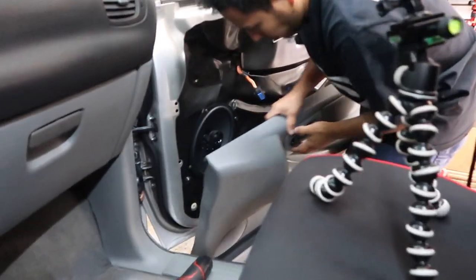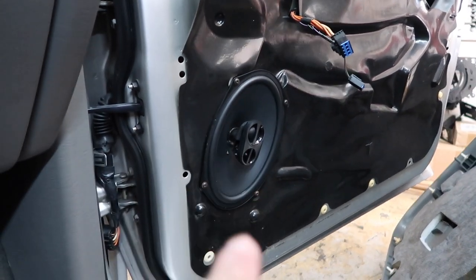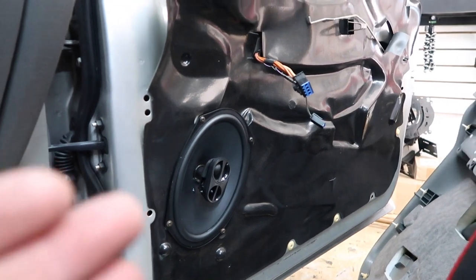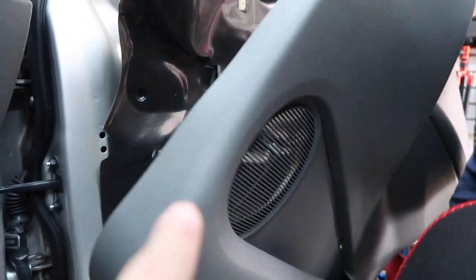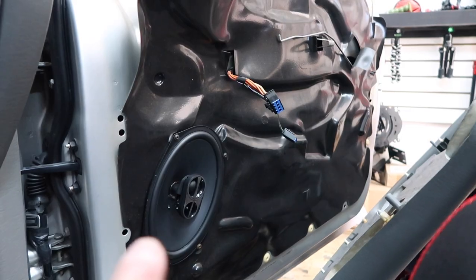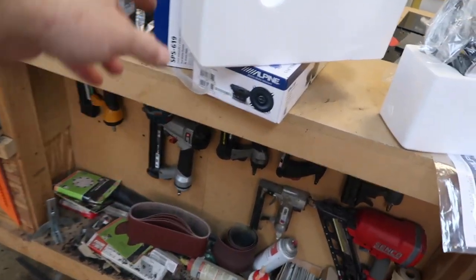Update on our speakers: the Exelons were just a tad bit too deep. They were hitting the window when we'd roll it up and down — there's a regulator that literally rides right behind the magnet. We were trying to figure out how far we'd have to space the speaker out, and it was about a half inch. If we did that, the door panel wouldn't go back on. We ended up having to switch to Alpine S-types so it would sit flush in the door. Normally we can make just about any speaker fit, but in this case it wasn't worth it — the door panel was hitting the surround on the speaker, which would just make it sound bad. At the end of the day the whole reason they're doing this is to make it sound better, so making it sound bad defeats the purpose. Right Fernando? Correct. So now we're going to go with the SPS-619s and the SPS-510s in the dash.